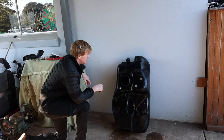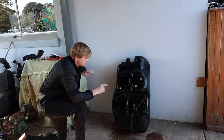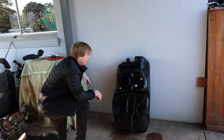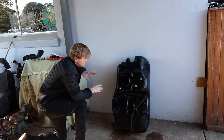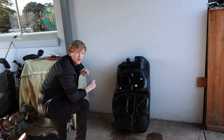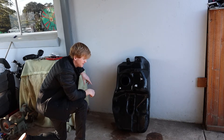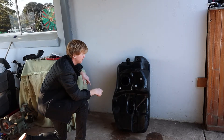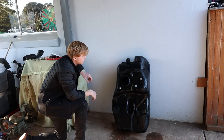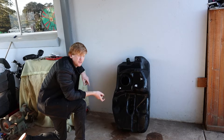Washed out the tank a couple of times with some water — it's very wet on the inside at the moment, but no more plastic, no more garbage, nothing on the inside, which is fantastic. Basically a clean slate, which is what we want. Only thing left to do now is to get it dry, then clean these up with some rubbing alcohol so that the epoxy has the best chance to stick. I think what we're going to do is hit it with a heat gun, go over the whole thing, get it as dry as possible, sit the heat gun pointing in there and get the entire inside dry. That'll then be ready to fill up with petrol when it goes in the car. Then we'll prepare the JB weld and the bungs and get them ready to go in.